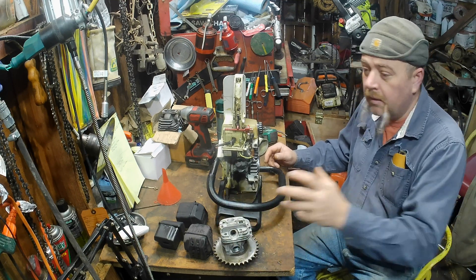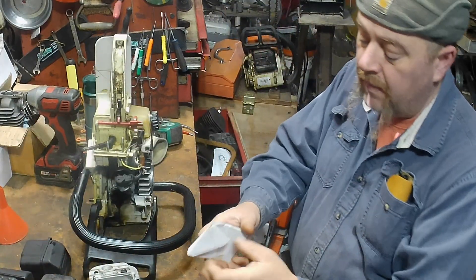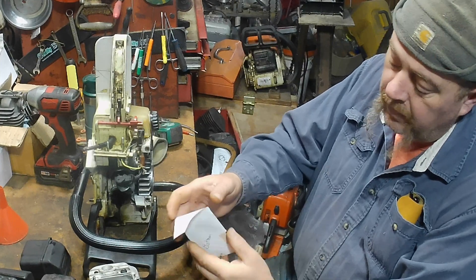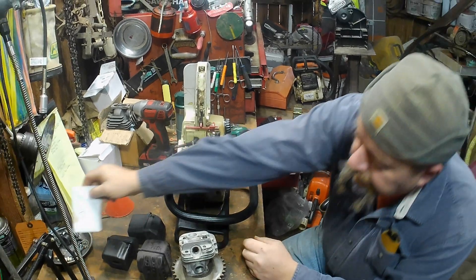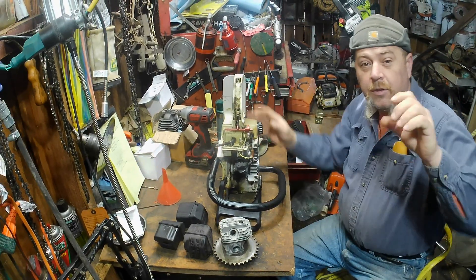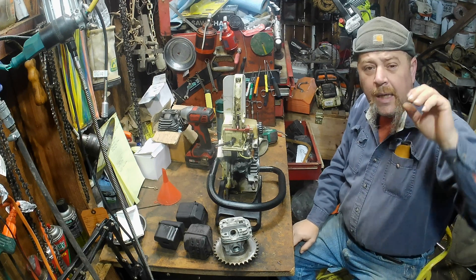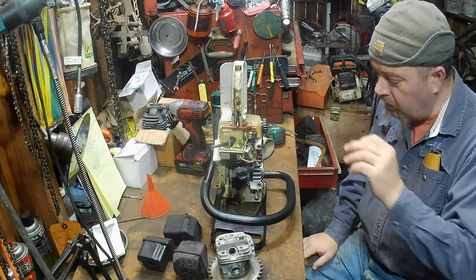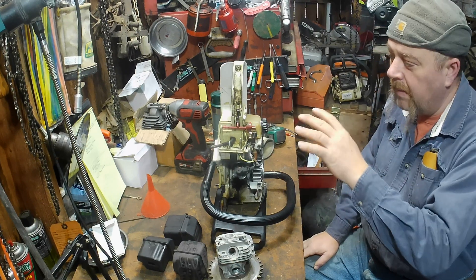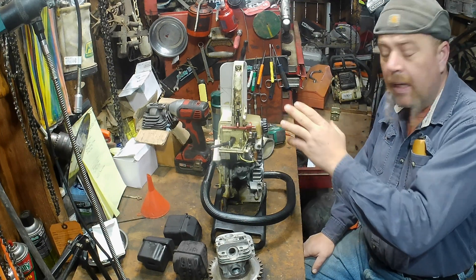Once I'm done here, the last time I put it together I'm just going to put it in with a single ring. If you want to keep your rings separate, use an envelope folded in half, taped, split that flap down, measure and mark them top and bottom. Keep your rings separate because they start seating in — you don't want to switch them around. We're also going to do some ignition timing, measure those, and that'll probably be about the last thing we do on this.